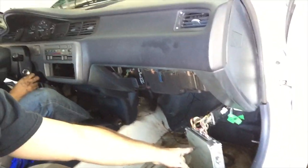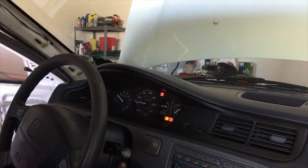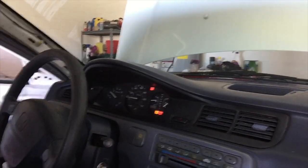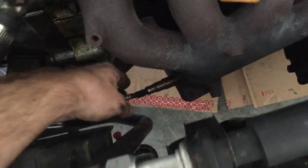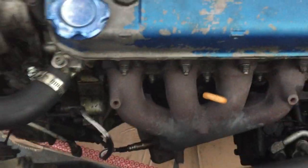Everything is wired up. ECU looking good. Wires run through. We've got the key. Let's give it a start. It sounds like it's running fine with the check engine light on. We'll go ahead and look and see what that is. The check engine code is still throwing the O2. So we went and I have this other O2 sensor — we just changed it out. You can see the other one still dangling. We're going to fire up the car again.